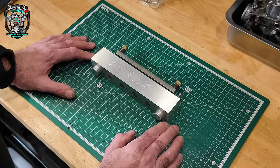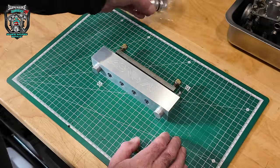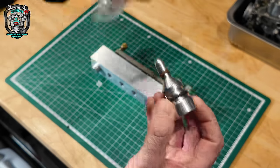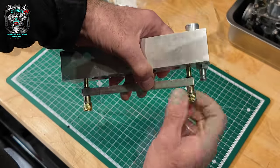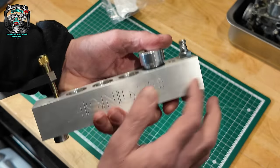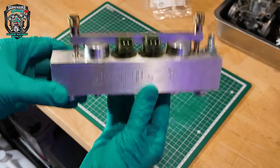I really couldn't be bothered standing at the lathe for an hour dicking around because my machining skills are fairly average. So I had a scout around online and found some of the original proper ones - they were £15 each. Dimensionally they're perfect, but the O-rings are just way too chunky and won't fit in the holes. So I found some smaller O-rings, put those on, got the injectors in the centre with a blank on each end, and let's test them.